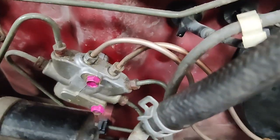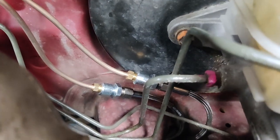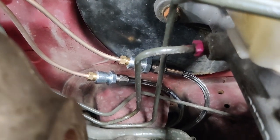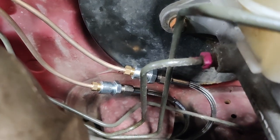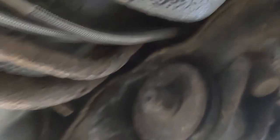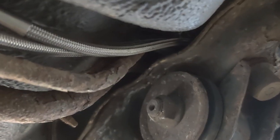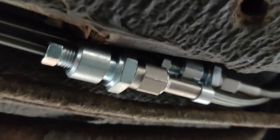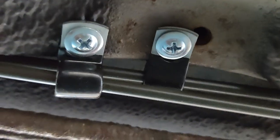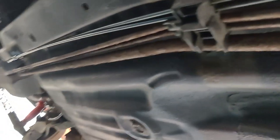The way I went about it is I have some 3/16 copper-nickel alloy coming off of the proportioning valve going to some adapters that adapt the hard line to the flex lines. These adapters are by Wilwood and they convert my 3/16 tube nuts to the dash-3 lines. Those tube nuts are for a 3/16 line but the thread on them is 3/8 by 24, so that's what you need to adapt them together. The soft lines come through the subframe and body to two more adapters, then to a long stretch of pre-made steel line from the auto parts store. To secure it to the body I used two P-clamps with self-tapper screws so it's tucked up nice and tight along the frame rail.